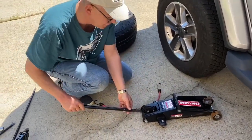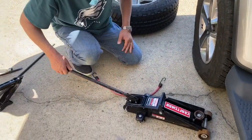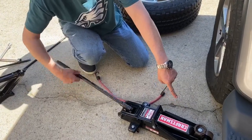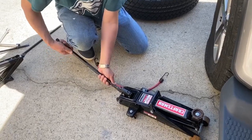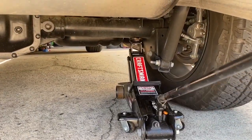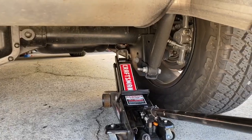And basically, you shove the hydraulic jack underneath the car, of course making sure that it's chocked up, as I was saying, and you jack this up and you see the lift portion of the jack raising as I pump the handle. And then of course, to let the jack down, you would just loosen that and the jack drops back down. And I've looked in the owner's manual and determined that they want you to place the jack underneath the axle right inside the tire.